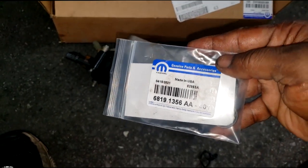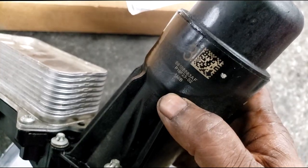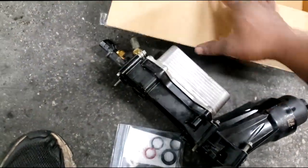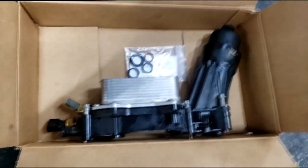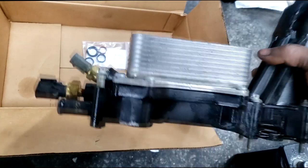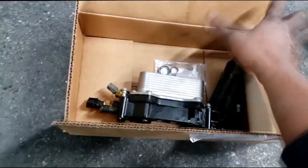I bought the O-ring kit, and is it risky? It depends - I wouldn't go below AF revision. This is AF revision - I wouldn't go below that. AG likely has the orange seals, and AG is top of the line. I'm going to clean this up, keep it in this box, take it over to Brothers Motors. Next one we get, we'll sell it from a used aftermarket standpoint - it'll be just like new because there's nothing wrong with the body, it was just leaking at the bottom. I'll change the filter too - remember, when you buy these they come with a new oil filter. I'll clean it with brake clean, verify the torques, make sure everything is tight.